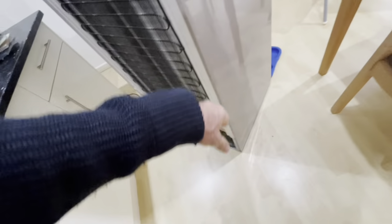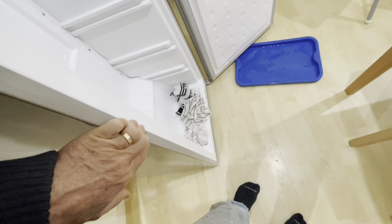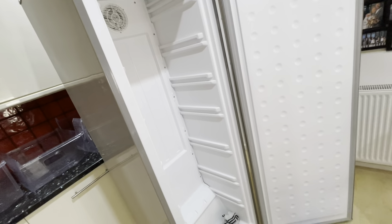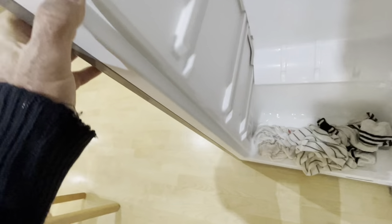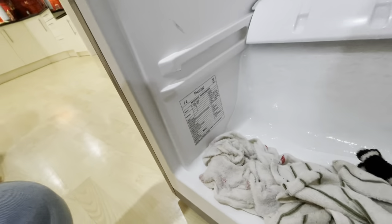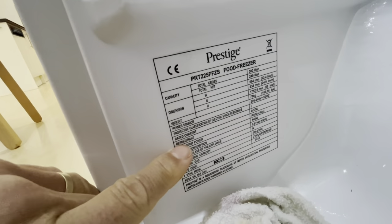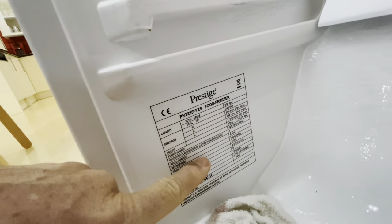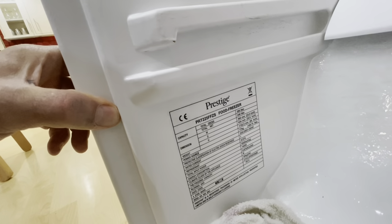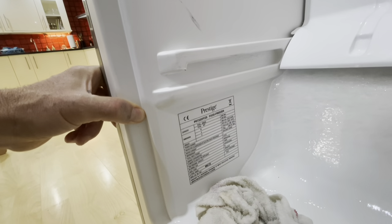I'm not going to go into too many details as there are quite a few YouTube videos on re-gassing. On mine it was just a problem of it icing up — I very nearly bought a new one. Models like this are quite efficient; they're about 750 pounds. Also worth mentioning, you'll see a little sign showing the refrigerant type — this one says R600a, which is the type of refrigerant gas canister you need. R600 is relatively new.